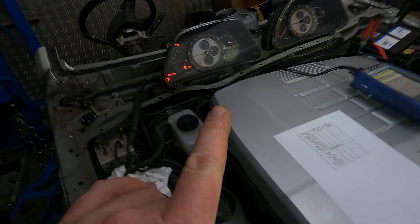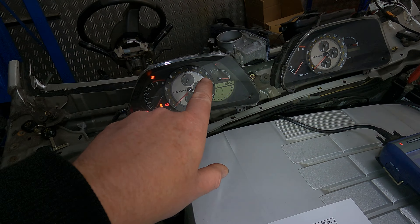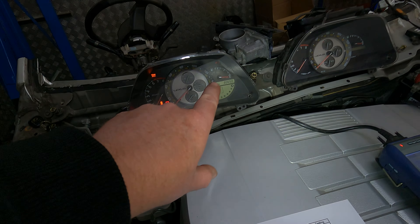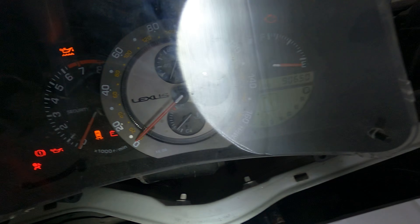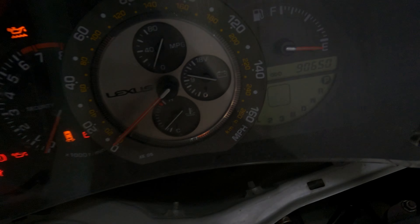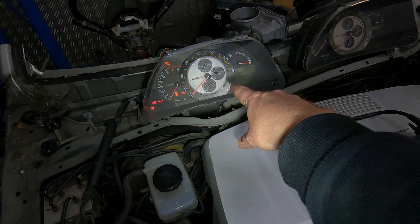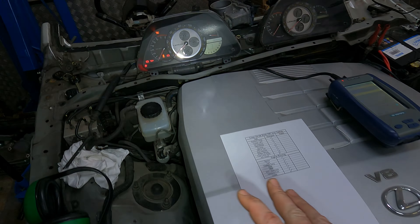Caveat with the six-speed: it's not designed to power an incandescent bulb, which is what these have. I haven't replaced it with an LED simply so I can show you what happens. You can see the check engine light is there but it's very dim compared to the bright warning lights next to it. I would suggest you replace at least the check engine light with an LED — then it'll be absolutely fine, bright with no problem at all. It powers LEDs no worries.